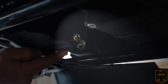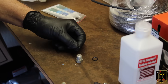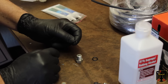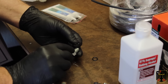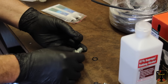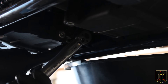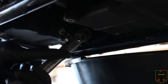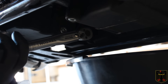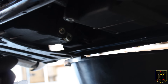We've drained out the oil. Harley recommends you put a new O-ring on before you reinstall the drain plug. I'm going to put a little bit of medium strength Loctite on the lower threads — it came from the factory with some kind of thread sealant, probably three bond or something like that. I'm going to torque this in at 22.6 Newton meters — that's Newton meters, not inch pounds. Now let's go change the oil filter.